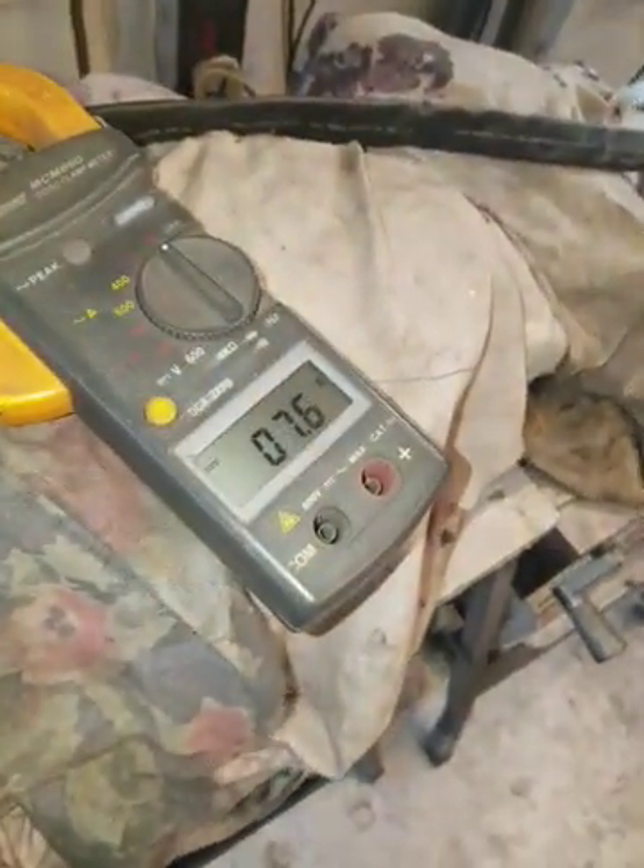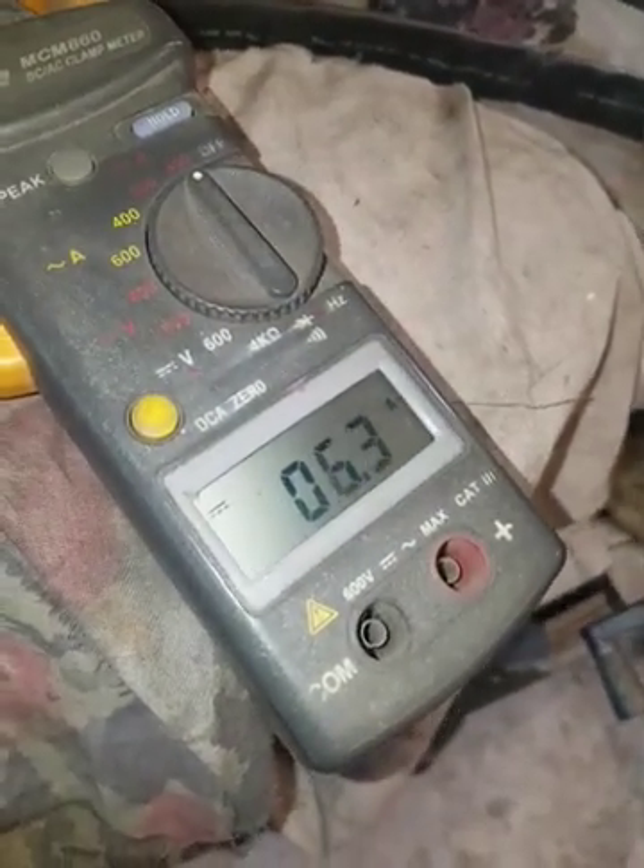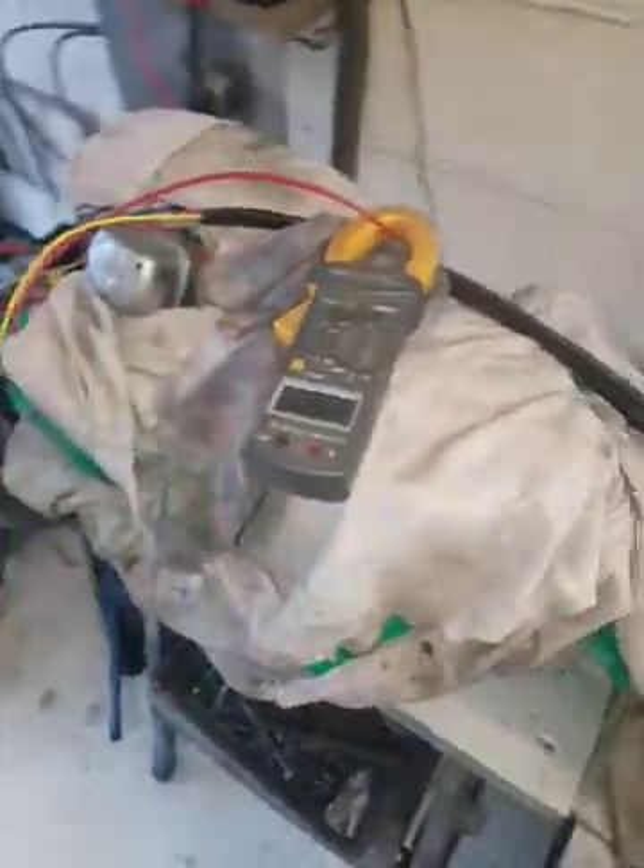You'll see the charging. If I give this a rev... that's about 7 amps at anything other than idle. It's exactly what you want.